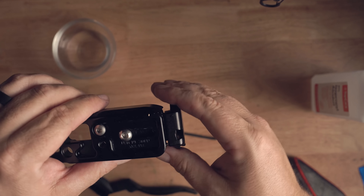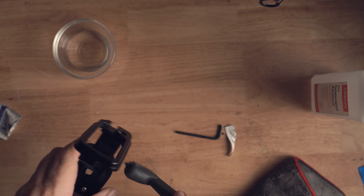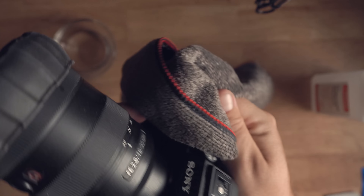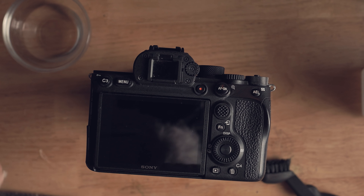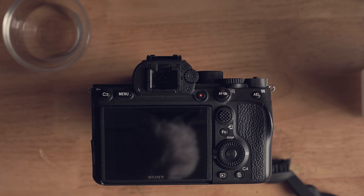I'll do the same with the dials — hopefully they're all good because dials are hard to clean. Then I'll look at the L bracket and clean all the nooks and crannies, making sure there's no sea salt corrosion in there. Once done, I'll take a microfiber towel and dry it off to help the excess alcohol evaporate faster. With the eye cup off, I'll also use a lens cleaning swab to clean the rear LCD and electronic viewfinder, dabbing up any excess alcohol with the towel.